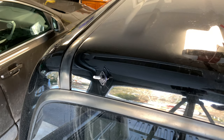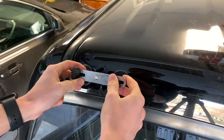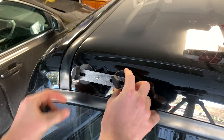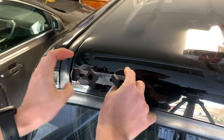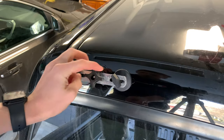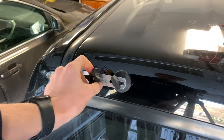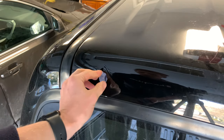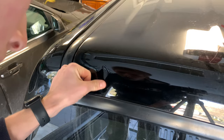After waiting just about five minutes to really let that hot glue start to cure and solidify and stick to the dent, you can start to screw on that dent puller contraption. Then you just keep tightening that middle knob until the dent pulls out. As you can see here, I didn't wait long enough and didn't have enough hot glue, so it fell off prematurely — so we're going to go ahead and try that again.